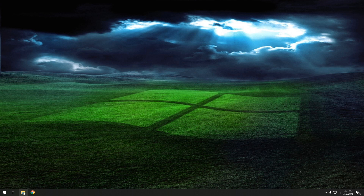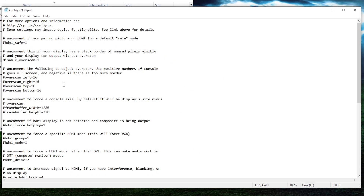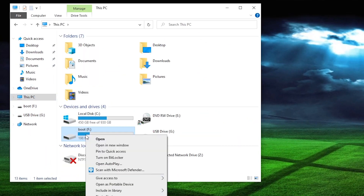Open your file explorer, go to This PC, and then go into the drive that says boot. Open this up and find the config.txt. Scroll down to the overclocking settings you just set and change them to a setting that has worked in the past, or alternatively comment them out completely. Then the Raspberry Pi should boot back up at stock speeds. Close and save the file, then eject the USB drive. Put your SD card back into your Raspberry Pi and it should fire up normally.